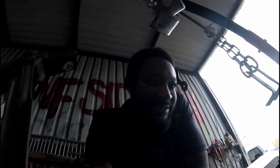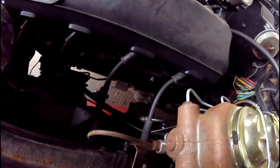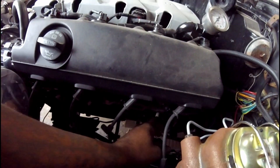After that fit up, we need to weld up a header. I'm probably going to need to order some inch-and-three-quarter 304 stainless tubing, because there is not much room in here. As y'all can see, the collector and the steering box are right here — it's so close to the engine that all four tubes have to meet into a collector right up in here. Those are some hellacious bends. I already got a header flange to start with, but I'm not going to be able to use the piping I thought I was going to use. That's cool though — we'll just get some and make it, and y'all will see all that.